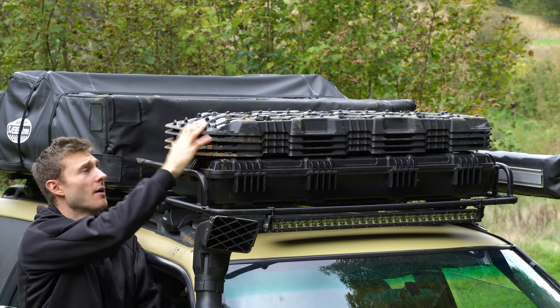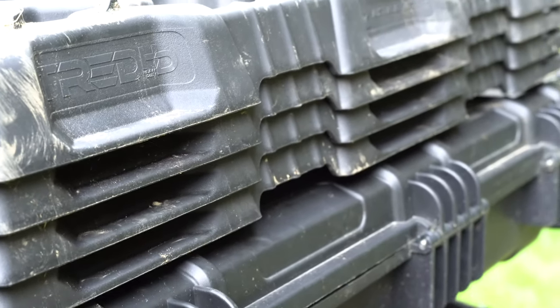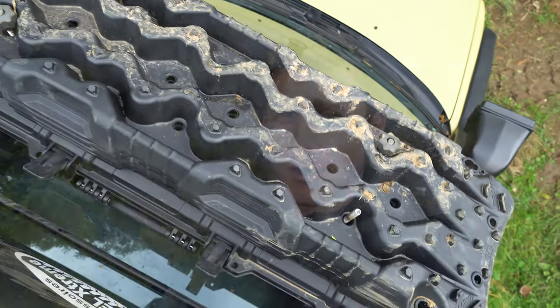I put my recovery boards on top of it with my own recovery boards bracket. I went for four MaxTrax HD recovery boards in black for the tactical look. A lot of people are gonna choose two recovery boards — the main reason is gonna be price, as they can be a bit pricey, and sometimes it's space and weight. But I went for four for a couple of reasons: first, with all-wheel drive on the Subaru, it's better to have one board on each tire for a better grip. And secondly, if you want to bridge something with the boards, it's better to use two boards on each side for less flex and better strength.